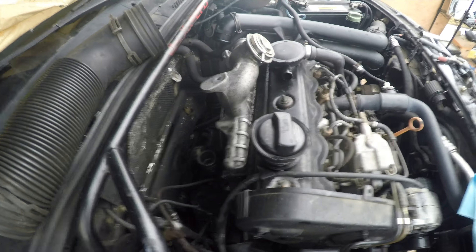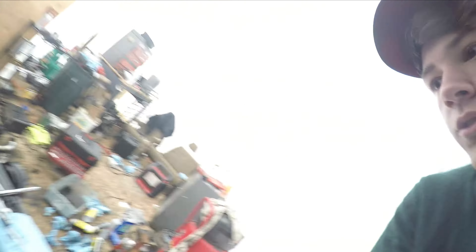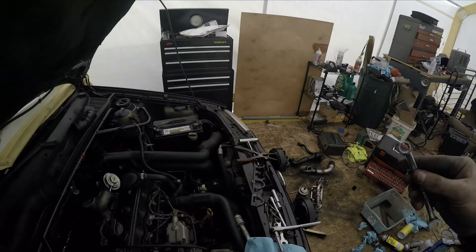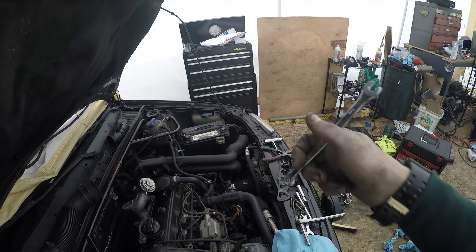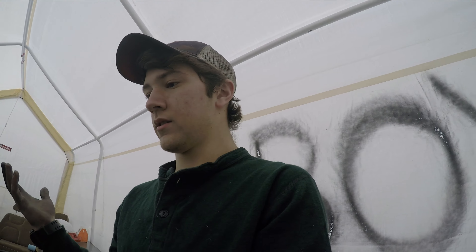The intake is on, just a little bit. I've got to torque them down — I don't really know if there's a torque spec, but what I do is take the allen key and wedge it through the wrench. It's a pretty common trick, and that's how I got them off. So I'm just going to torque them down to what I think is good. They're new bolts so they're not going to strip. Then I'm going to put the EGR cooler on and the turbo lines and everything like that.